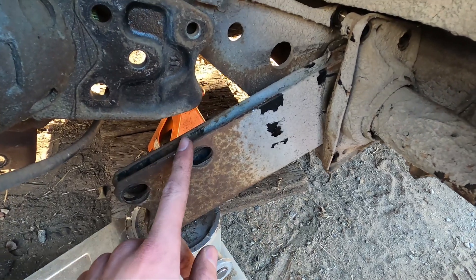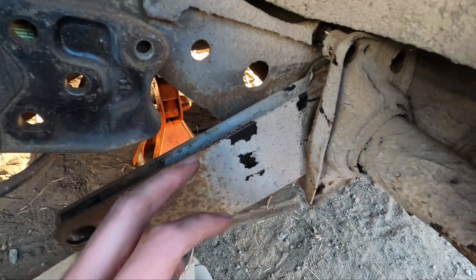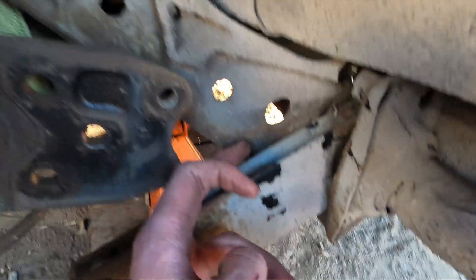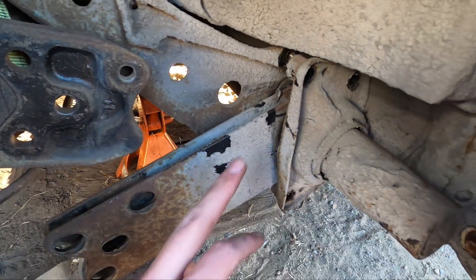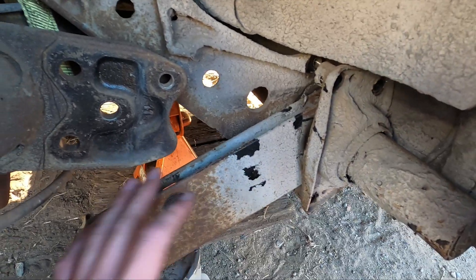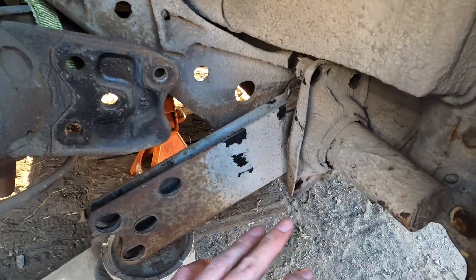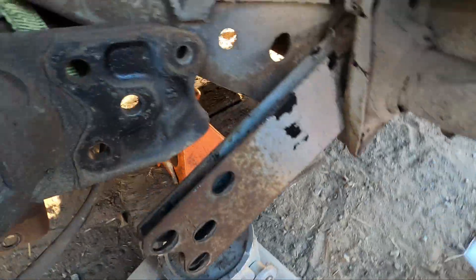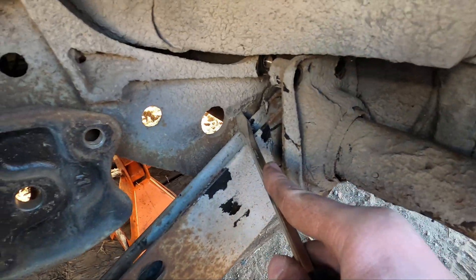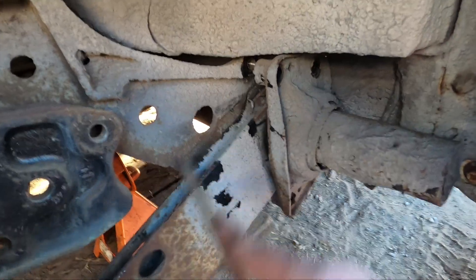The reason I was hitting on these with a hammer still after it was no longer attached to the jack is because the back side of this plate is rubbing up against the ledge we popped it off of. So just to make sure there's no load on the torsion I hit it down, and now that it's not moving we know there's no more load on the torsion bar. So we're going to take our flathead again and go ahead and scribe it — just get a nice mark in there.